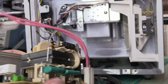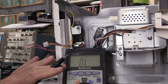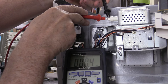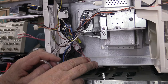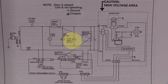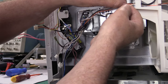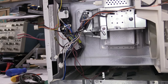This board is working - it's been tested. One of the last things to test is the magnetron itself. Put the multimeter on ohms mode, contact the two prongs, and if you get a very low impedance reading, it's fine - this magnetron is good. Another potential problem is the little motor under the cooking cavity that rotates the platter. The fan motor is also working - I've seen the fan rotating. Now it's time to reassemble and hopefully it works.